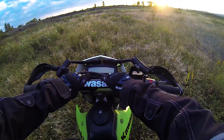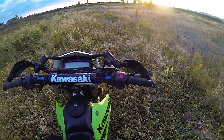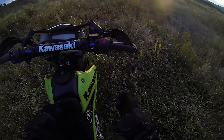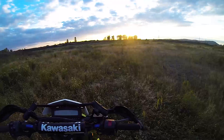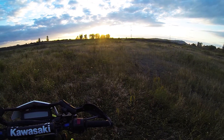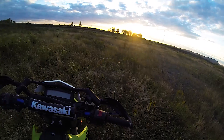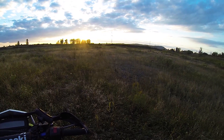I'm just trying to keep this thing going for now. It feels great since I retuned it to two and a half turns out on the air-fuel mixture — that actually made a pretty good difference. That's why wheelies are so easy now. Feels much better than it did stock. Stock was closer to three, three-something turns out. So two and a half turns out — anybody and everybody should check that on their bike.